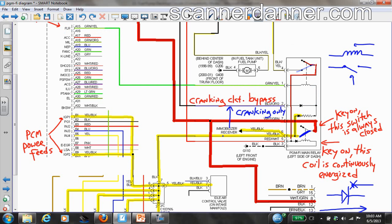That can't be right, because when you let off the crank position and the engine is running, the fuel pump stays running. So when the engine is running, this cranking circuit is dead, which means there has to be another power feed to keep the coil energized. That's what the yellow-black wire is for. When is the yellow-black circuit powered up? With the key on, engine cranking, or engine running — it's powered all the time. So power runs this way to injectors and idle air control and also across a resistor up to the coil.